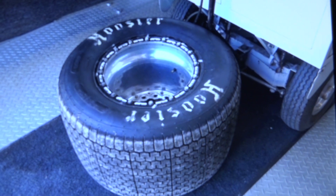There are a lot of different tire sizes. When you buy tires, you'd want to buy tires that are different sizes. It's kind of a guessing game with the chalk marks, which are kind of bogus anymore. You take the right rears — they're a 95.5 chalk mark — and the left rears would be an 89 or 89.5 chalk mark. You're just hoping the left rear comes up to 85 or 85.25, and the right rear comes up to 92.75 or 93. The chalk marks have been so off the wall lately that it may not show up, so that's why you need 10 to 12 tires mounted up at all times.